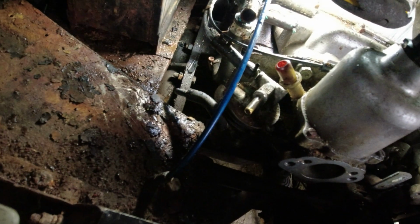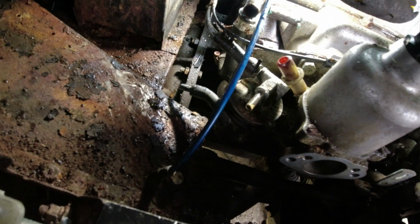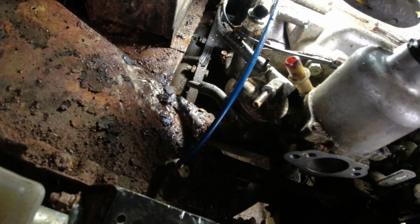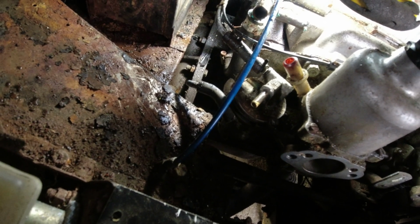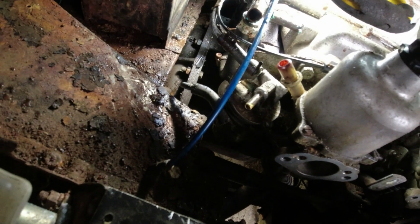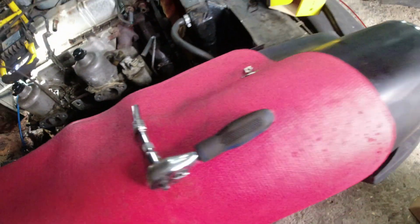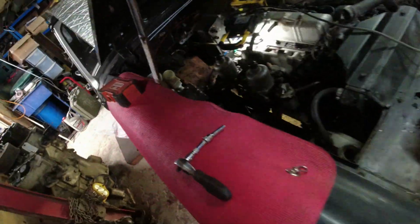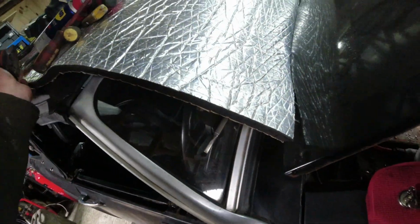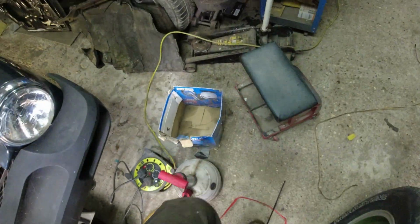But never mind. Once I've got all these hoses and everything off, and I've got a shopping list for bits that I need to buy, then I can get on with that. Now, the main reason for actually doing this is because I wanted to get the fuel line replaced. This little short length of fuel line goes across the back of the engine to the pump. Let's take the non-flickery torch with us. Tiptoe past all of the cooling stuff.